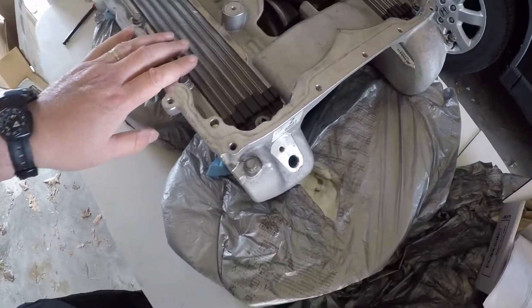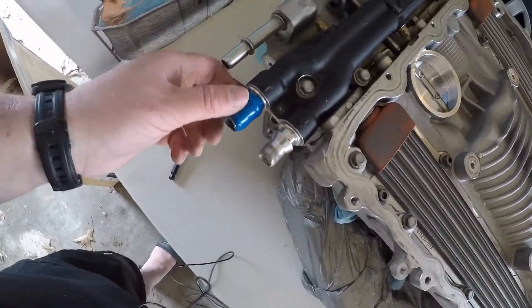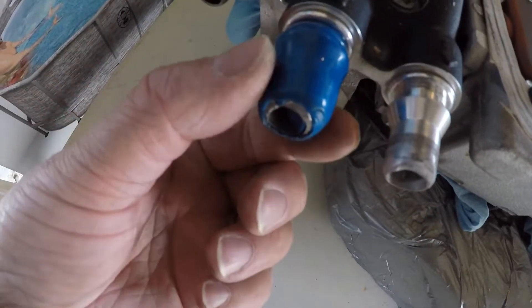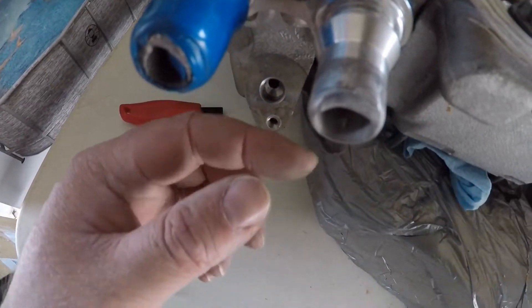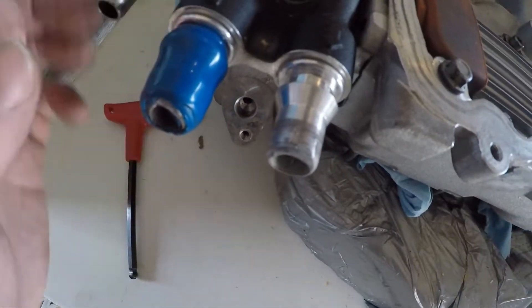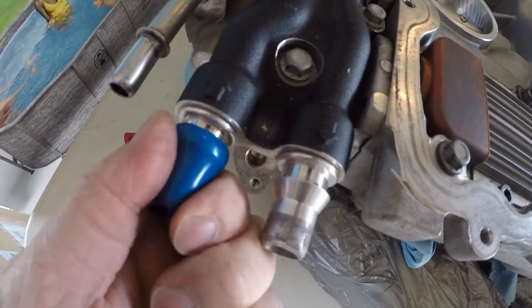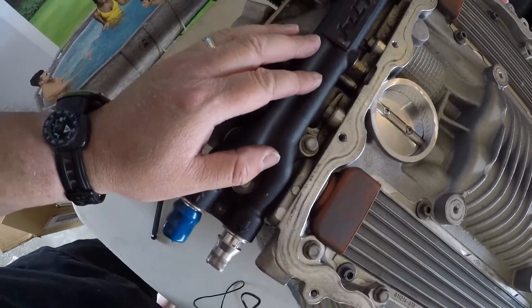Overall, just looking at this thing at 40,000 miles, it's not in too bad shape. The coolant manifold here — I'm not sure if it got dropped, but it looks like where the quick connect disconnects go it did have a cap that came off, and it looks like this section may have gotten dinged, bending that middle section slightly. The actual fitting part looks to be in good shape though. If needed I could use a round file to clean that up, or worst case I can unbolt the coolant manifold and replace it.